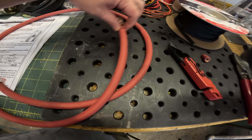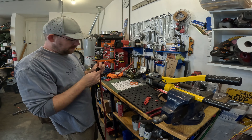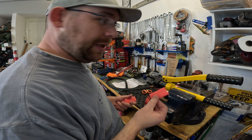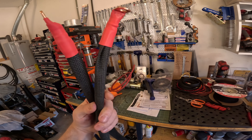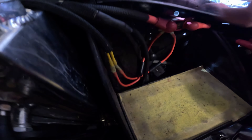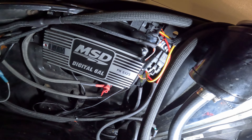This is our raw new battery cable. I need to put some heat shrink on to seal these ends up, then put a covering on it, and it'll be ready to go on the truck. Because these are positive cables, I'm going to use red heat shrink on the ends so it's always clear — red, danger, this is hot, this might hurt you. Here's a look at the final product before we put it on the truck: the 90-degree end will go down on the starter, the straight one will go on the kill switch. Update on the relay situation — we now have two relays, one for each fan, tucked up in there, and they work great.